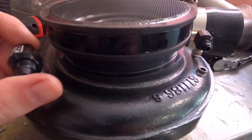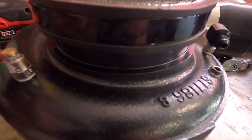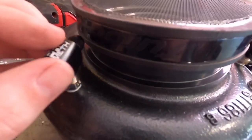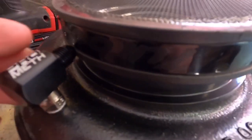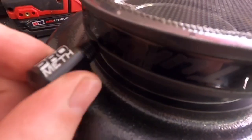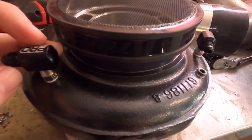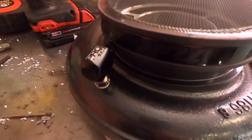This is what I was talking about — be careful where you put the nozzle. I tried to drill it in the dead center of the volute for the best spray pattern. See how this thing is shaped? When you go to screw the nozzle holder on, it hits. I'd never be able to tighten that down. If you were just a little bit more over, it would hit the actual metal housing of the turbo. This kit comes with zero instructions — at this level I guess they just assume you know what you're doing.